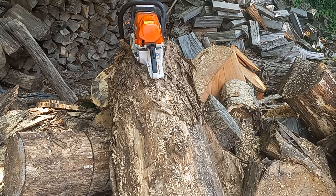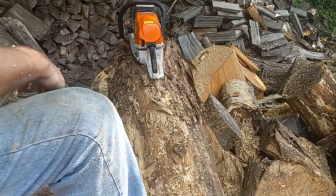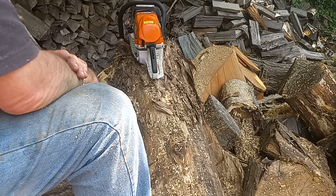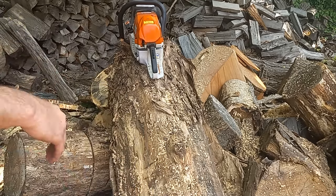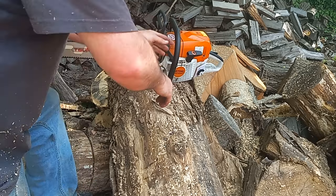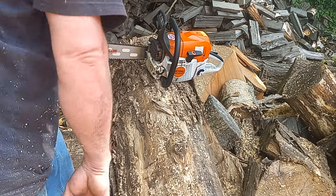It just feels so weird running a 67cc saw that's making almost 9 horse. It's making 8.8 horse. It might be a touch more than that since I gave it the extra muffler mod. It's got an extra outlet on it since when it was dynoed. I only had a single 1-inch outlet on it when I had it dynoed at 8.8. And last time I was dinking around with it, I gave it a Dyno Joe deflector and another outlet on this side.